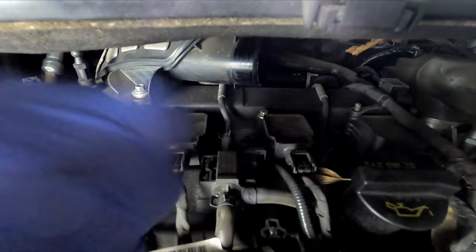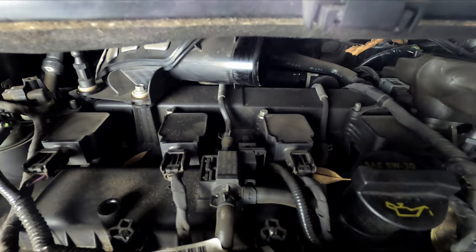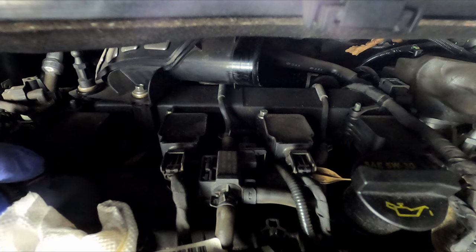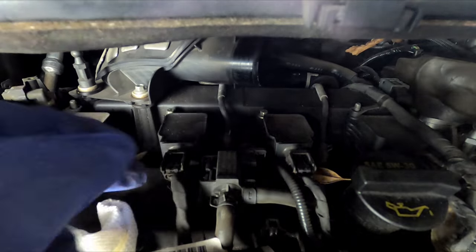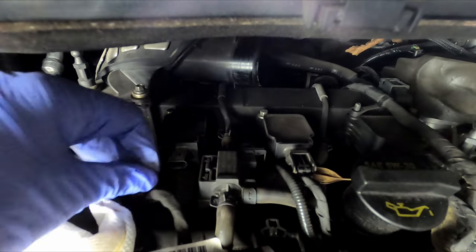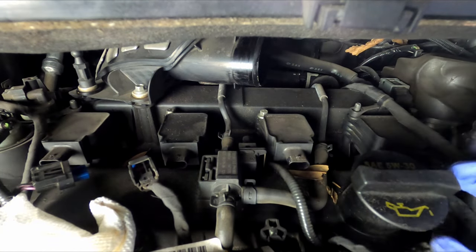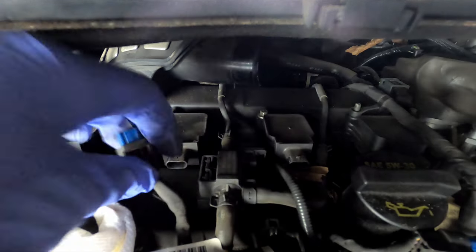So it's going to be a little bit easier to work in here if you remove the oil stick. So pull that out of the way. All right, so next now you're going to want to disconnect all your coil packs. So all you do is you press down and pull back. They come off really easy. Just move those out of the way. That's for each one. Once you get all four coil packs disconnected,